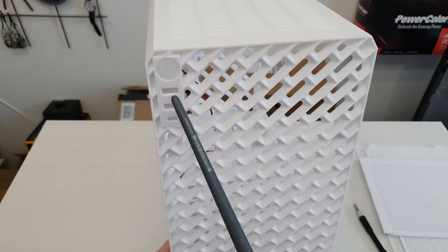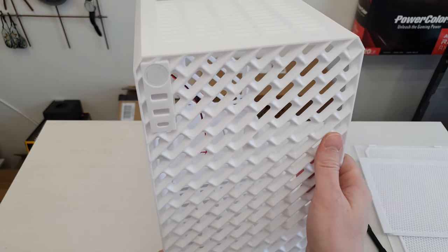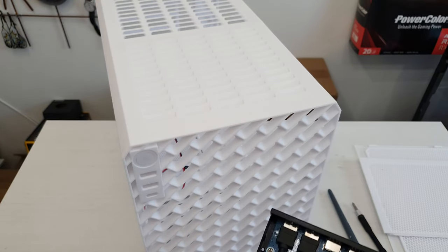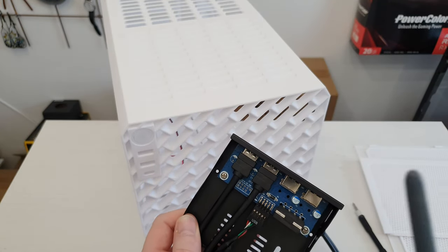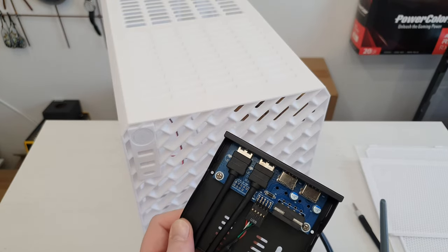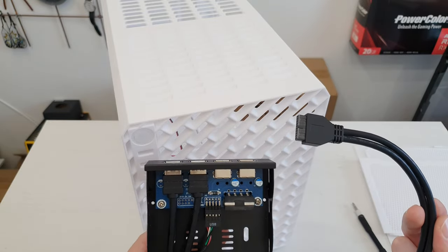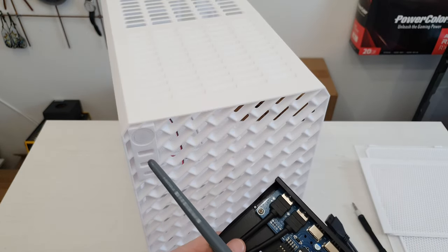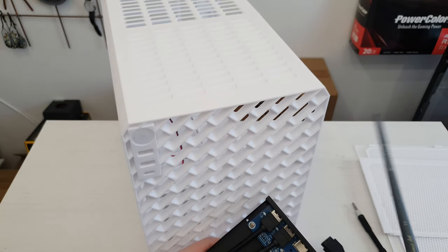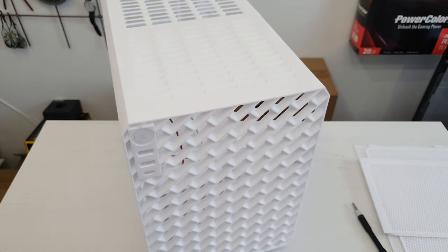For the front USB we have two standard USB Type-A and one USB Type-C. In both cases you would have to buy expansion or extension cables. For example, this adapter has two USB ports soldered on a PCB — I've bought something like this from AliExpress for testing but it hasn't arrived yet. These connect to the motherboard and the USB ports are plugged into holes and secured with a bolt or screw in the chassis. The same works for USB Type-C, but you need to buy a USB Type-C expansion cable and ensure that your motherboard supports it.